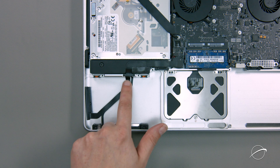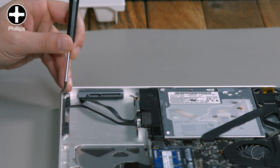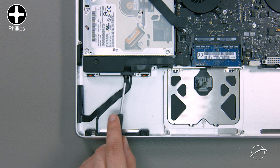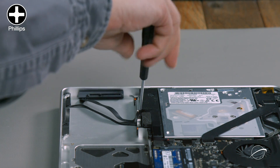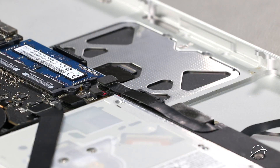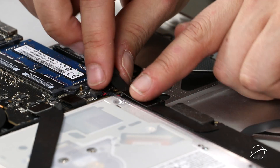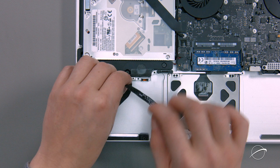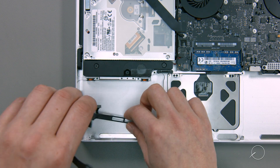The hard drive connector cable runs across the top of the speaker assembly and along the bottom of the drive bay, and also includes a component that attaches to the front end of the MacBook Pro. First, let's remove all the screws holding the cable in. Start with the two holding the front assembly in, then remove the two small screws holding the cable itself near the top of the bay. Now we can detach the ribbon connector by gently lifting it up and off the logic board. You can then peel the drive cable up from the MacBook Pro — it's mostly held in by adhesive. Once you've done that, the front assembly should just slide free.